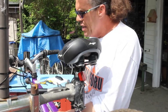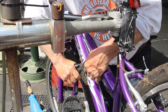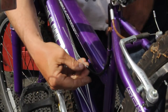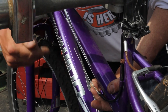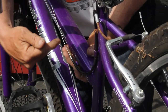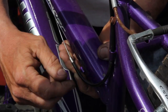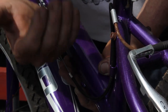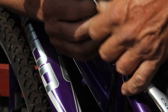The first step with any of these bicycles is — I'm just going to go with a new cable. I know I've got to do it. I'm going to snip it with a pair of dikes. What happens is the cable sits right here and the moisture hits it, drips down, and sits right in here, and the cable gets a little corroded and gooky. We're going to find out when I unleash this — the cable doesn't run nice and smooth in the casing, so we're going to replace it. Let's see what kind of gunk is inside.